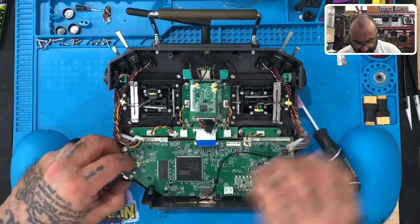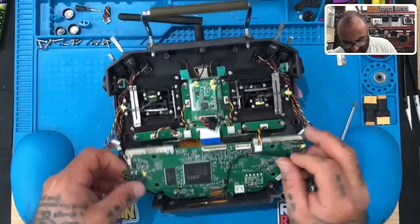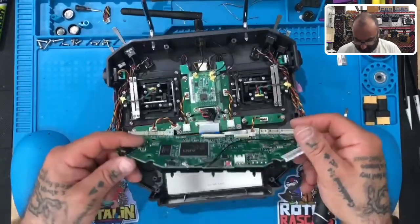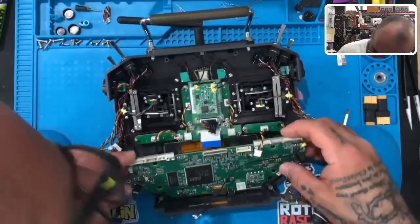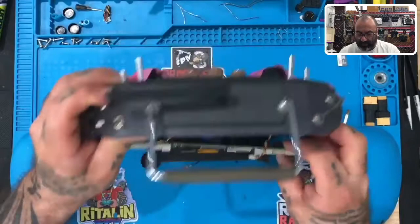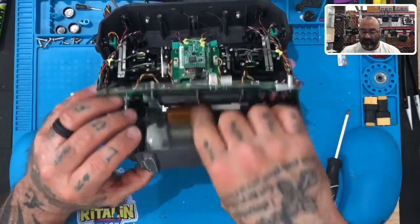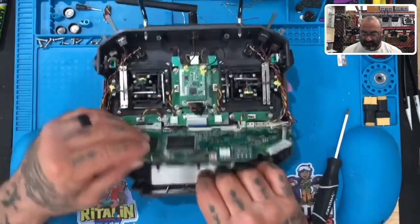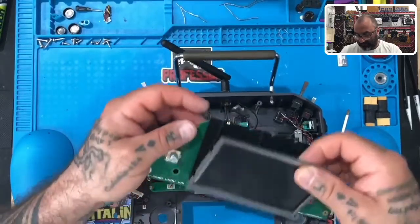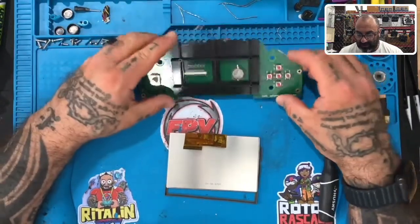Let me make sure I've disconnected everything. There we go — you can peel this antenna off if you're going to the new board. Be very careful: once you pull this up, what you're going to see is the LCD screen connection. Tilt it forward, lean it back — you can take the LCD screen out if you want. You have to make sure you disconnect this ribbon right here. Lift that up — the board is now out.